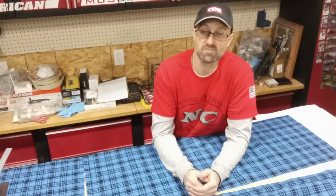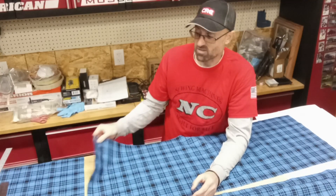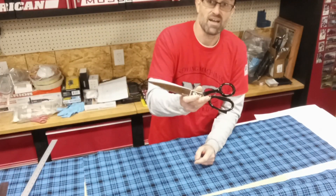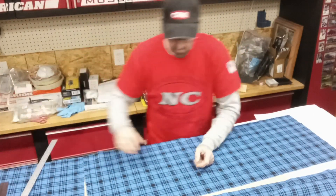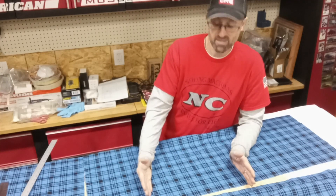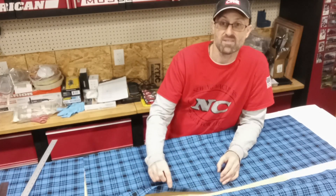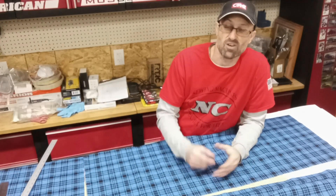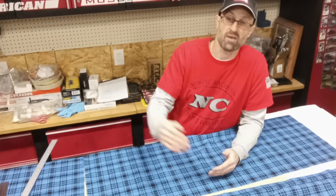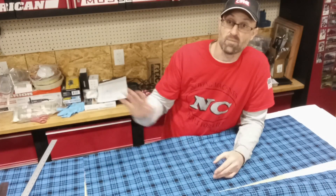It can get to 45 in a couple of areas, but cutting a rectangle at 16 by 44 is going to be pretty good. I've cut my material here, measuring it out with big long rulers and cutting with my Italian shears. The piece is a little over 44 wide and about 16 deep — just slightly over 16 at about 16 and an eighth — to keep with the pattern. Anything deeper than 15 or 15-and-a-half will go under that panel and look very clean.